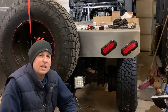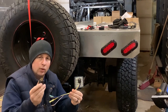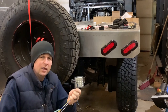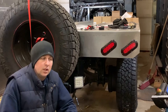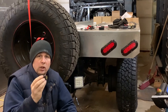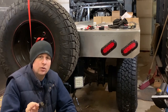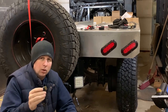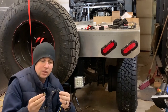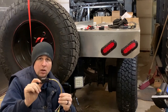From the last video when I wired up the tail lights I elected not to use a relay harness and instead wired directly to the relay. This time with the reverse lights I'm going the opposite direction, and my main reason is this is a live circuit off of the battery — it's not switched through the ignition. When I use a relay there is always one terminal that's normally closed, so 87A will be energized all the time. By removing the wire from the relay socket that 87A is connected to, when I install the relay the 87A pin is protected from anything contacting it.